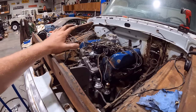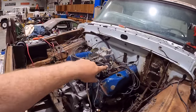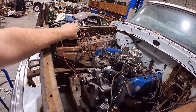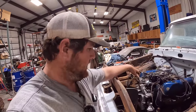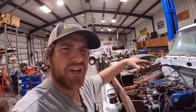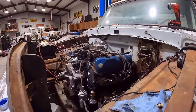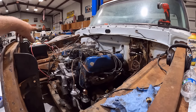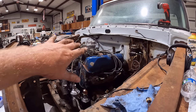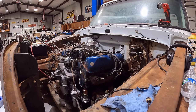We're back topside. I got the starter hooked up, the exhaust hooked up, and a battery hooked up. I have the cab-to-engine ground hooked up, then the ground going to the battery, and then the cable going down to the starter. Basically the absolute bare minimum to hear this engine run. This thing's been off the road for quite a while, so hopefully all the connections are still good — like to our coil and our starter solenoid. There's no fuel in the carburetor yet so we'll be cranking on it a bit until we get fuel up there, which will also give it a chance to prime the oil system.